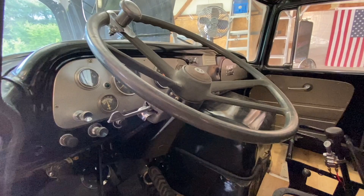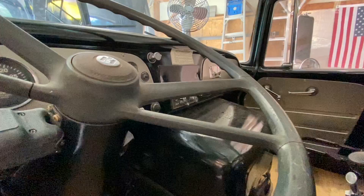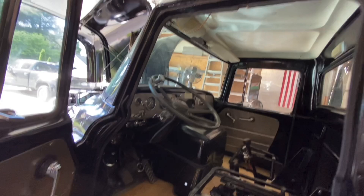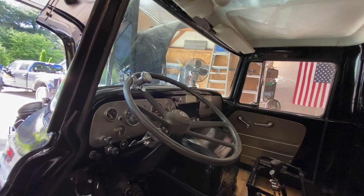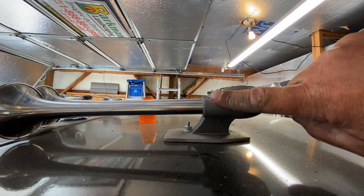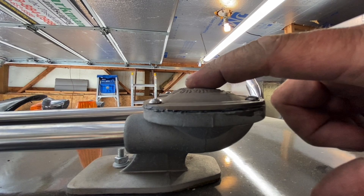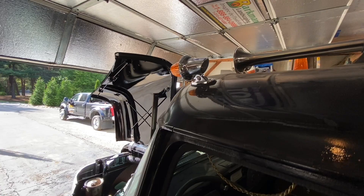I've got the airline feeding off my compressor. We're up at 120 pounds in the tank — that feeds the spring brakes and the air horns. Remember when I blew the air horns a few videos ago and everyone said they were okay but not very fitting? Well, I found that when I pulled the chain there was a whole lot of air leaking out. So I took them apart, re-gasketed everything, and now we have a much better, more fitting sound.